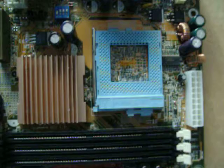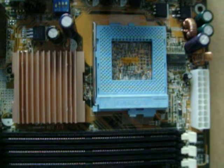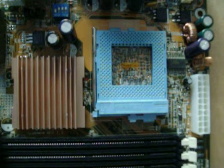The Pentium 3 had two versions: one with 256K and one with 512K of level 2 cache. All Pentium 3s ran with a 133 MHz frontside bus. So if you had a low-end Pentium 3 with only 256K, the only difference between it and the Tualatin Celeron was the slower 100 MHz frontside bus on the Celeron.